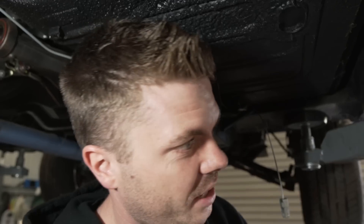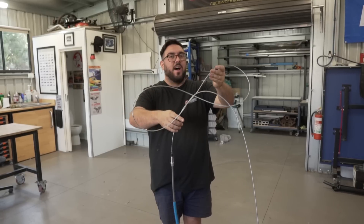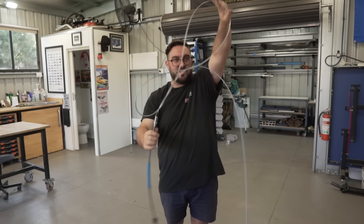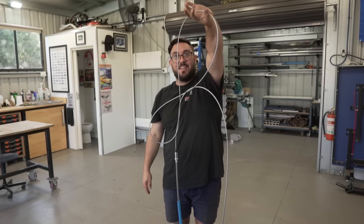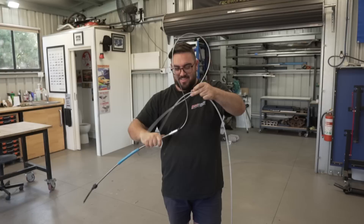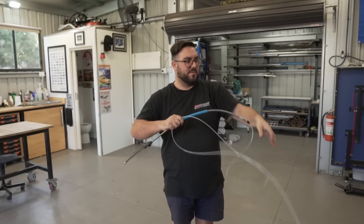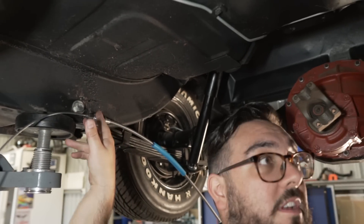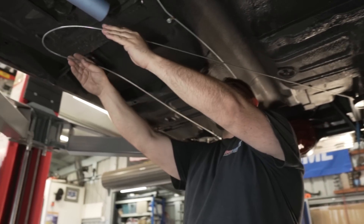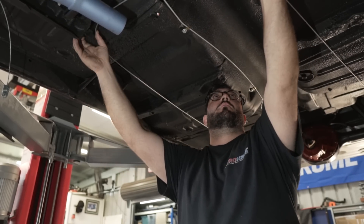This has to connect to the second bit of handbrake cable which splits into two and goes towards each drum brake. I think let's run it to the diff and forward, then meet in the middle and work out what has to happen there. I don't know how it works - it just loops forward to that and when you pull it... this is one continuous loop. I reckon we're missing like a pulley, you know, like how the HQs have that thing. I think that's what we're missing. We need two more A-clips to hold that, and this must loop forward, but it can't surely just go like that - it must feed across to like a pulley system.